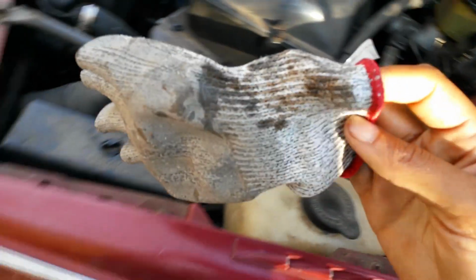What you want to do is prepare your oil filter to go back on. Put your keys down. Drop your bonnet. Alright, now I technically need a rag, but I'm going to use the bottom part of this glove. So what I generally do is, where my filter came out, I reach up in here, and where it screws on, I just wipe it. Make sure there's no old gasket material on there. There's a little rubber gasket on your filter, but you see it's not going to be much oil at all. But you want to make sure that there's no gasket material, which since I do my own, it's never.